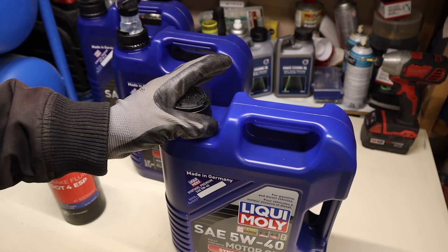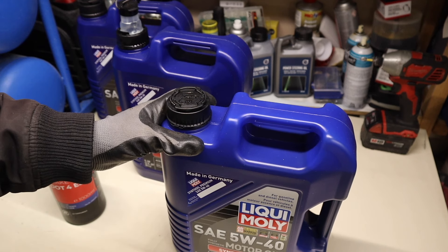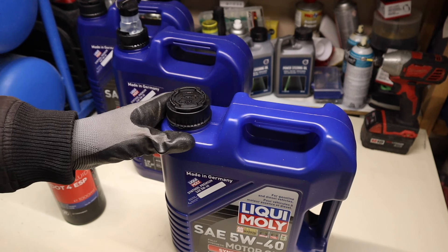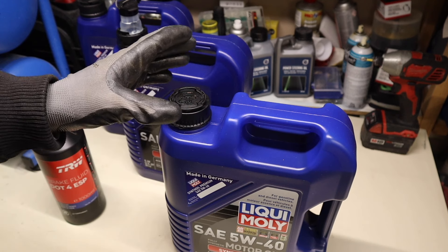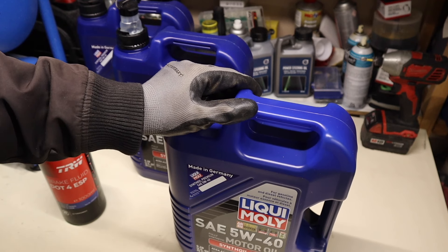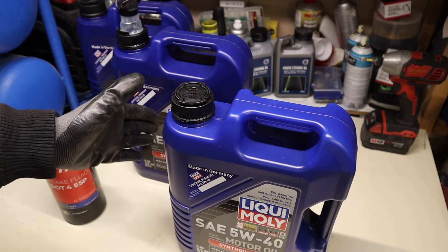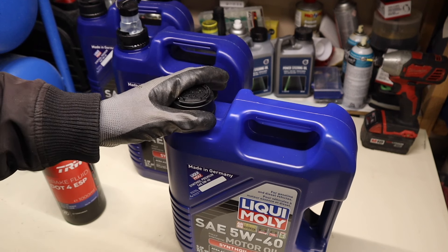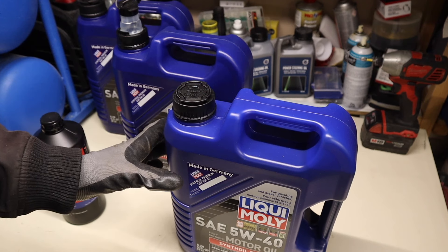I don't know the size of my oil cooler but mine looks like a stock setup, so really keep an eye on your oil level at the beginning if you've done a service like I did in the eight-part series. Although the low oil level sensor will save you, these are sensitive cars built to precise specs. Use the dipstick, spend time and a couple of drive cycles and cooldowns, then check on level ground and continue to fill as much as you need. Make sure to do this before the low oil light ever comes on.